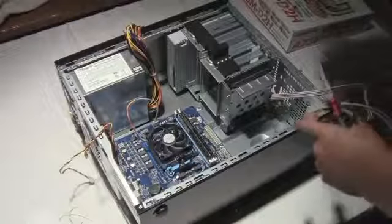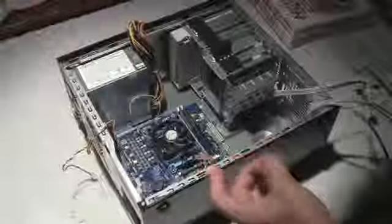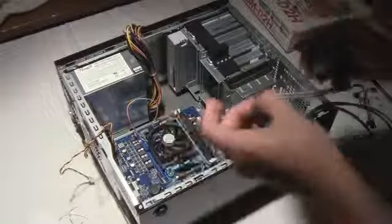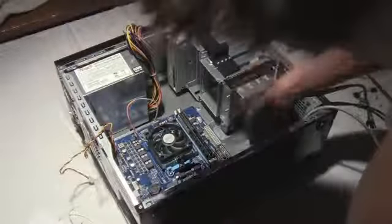All right, got one. Good. So now the other ones are all there, and hopefully it'll be very easy to align these all and screw them all in. I'm going to fast forward this for you guys so you don't have to watch all this. You don't want to screw them in very tight. You do not want to crack your motherboard at all.